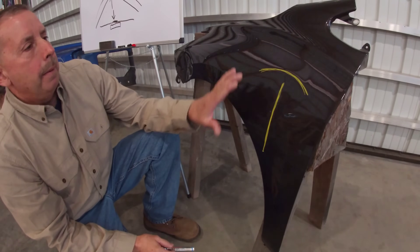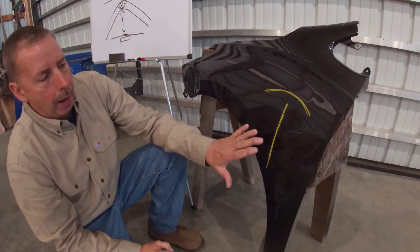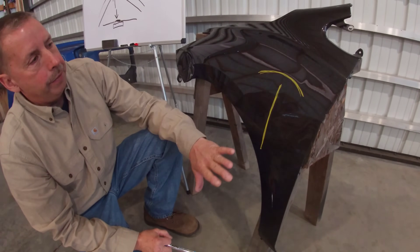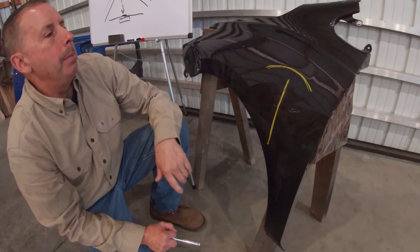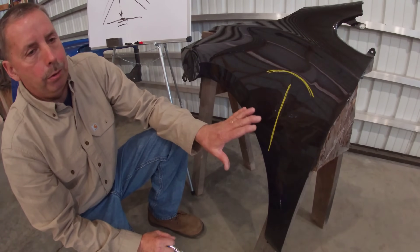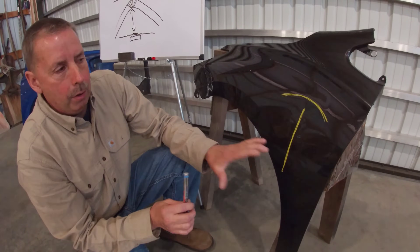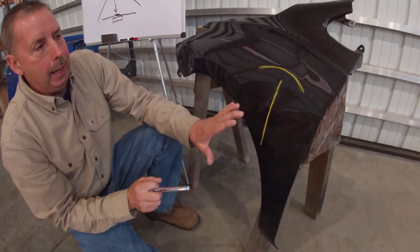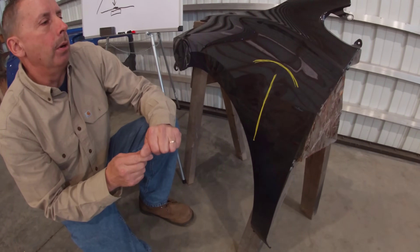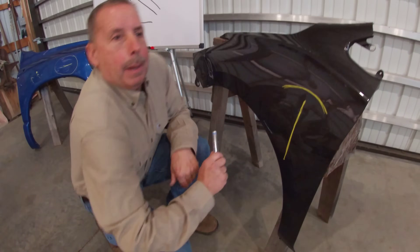So what we intend to show you is how to work all this out — relieve the stress without causing any more damage than necessary and without making the work hardening worse — and get this done in one step, probably one coat of filler. You're not going to have this high spot that keeps giving you problems. In the next video, I'm going to show you choosing the proper tools for this. There are different types of hammers and dollies — most people say find one that fits the curve of the metal, and that's true in probably 90 percent of cases, but there are other things to look at. So the next video will cover tool selection before we actually get into showing how to work these dents out. Thanks for watching.